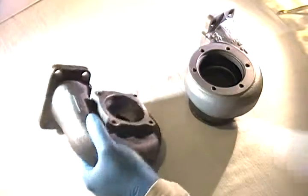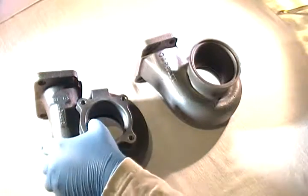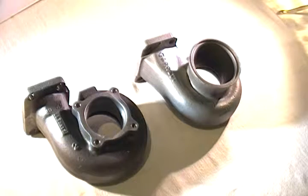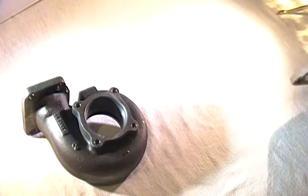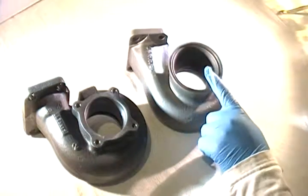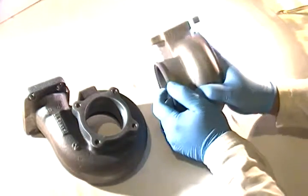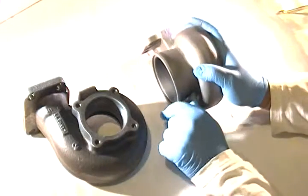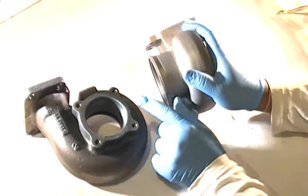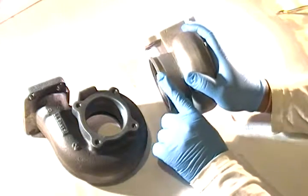But a lot of people still want to be able to have V-band downpipes. That's really important for ease of dismantling the turbo system or being able to access other areas within the engine bay. Some manufacturers who have the capital — including competing brands — actually have a turbine housing that works with this. It looks like a T3 inlet with a similar V-band flange, but most of them aren't conical like this, which helps with flanging access and with the vortex effect on exhaust gas energy.